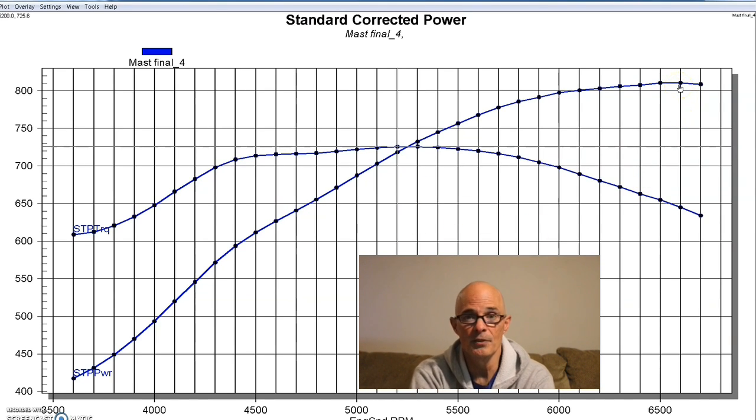It wasn't revving very high, but we ran it to 7,000 RPM regularly without any problem. We ran a bunch of intake manifolds and different LS7 heads — you can search 'LS7 head test hot rod' to see how they compared against the factory head. So this is our final 800 horsepower combination: NA, alongside all the turbo, nitrous, and supercharged options. Which one would you choose?